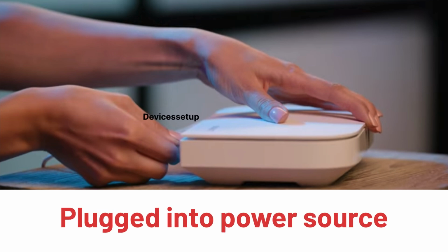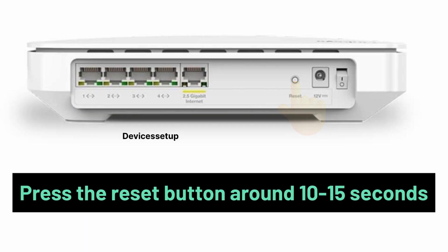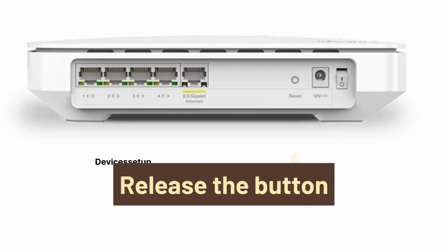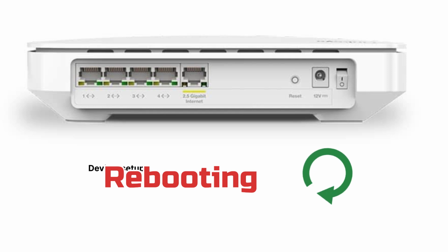To reset your Velop router unit, first make sure it is plugged into a power source. Next, press and hold the reset button present on the back side of it for around 10 to 15 seconds. After this, release the button and let the router unit reboot.